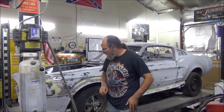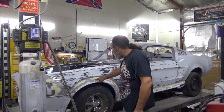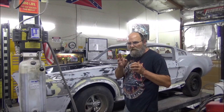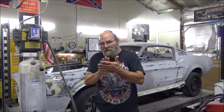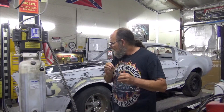I'm not going over everything with finishing putty. Like right there - you can't see it but I can see it - there's a little pit up there. The problem is they add some little pits that pop into it after you get to working with it for a while. The sealer should take care of that, but we're going to take the finishing putty and try to fill them in and smooth them out. After we put the sealer on we go back through, because you can put anything on the sealer, and we can take finishing putty and do dress-up in little spots that just didn't turn out so perfect. But that's got everything caught up and now you know what's going on.